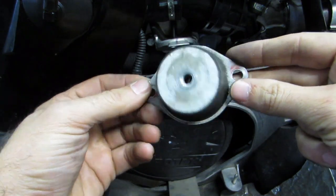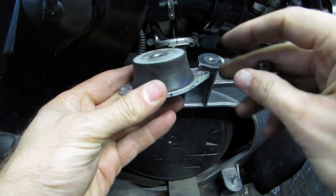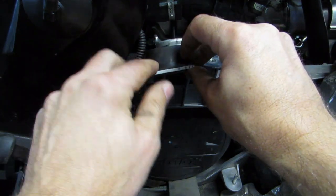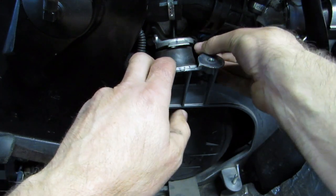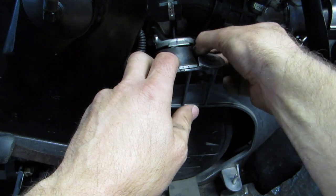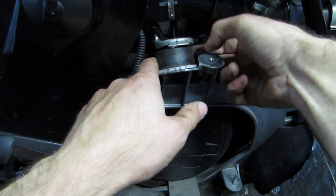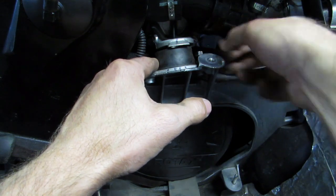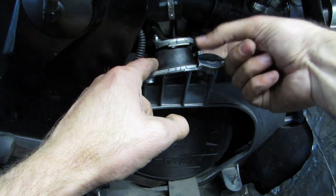All the sleds I've aligned have needed that. You want to put the slot in the back and the enlarged hole in the front. Once you drill that, you can slide it back in and start these bolts. Once you get both bolts in there, you can see how you can move the mount forward - slide it forward, then tighten your bolts down. Then put your top bolt in and your shims. And that's how you move the mount forward.